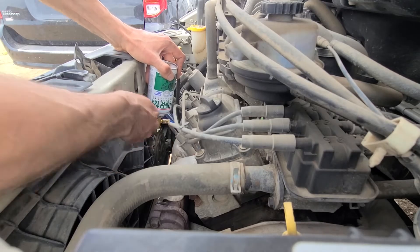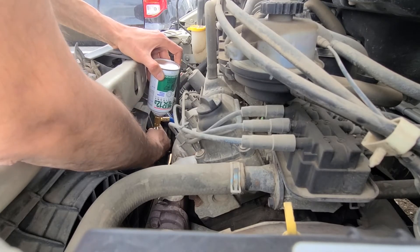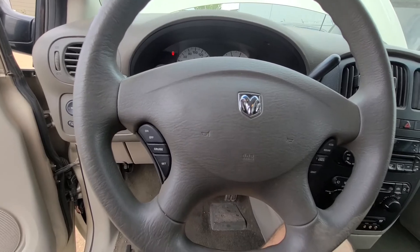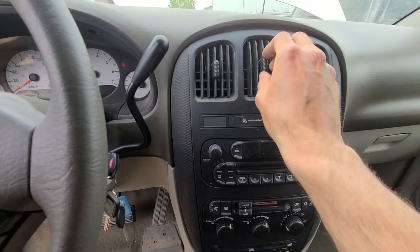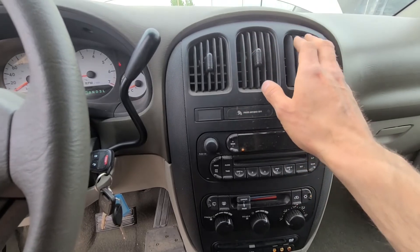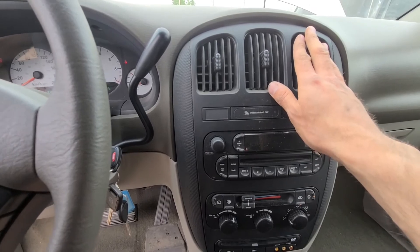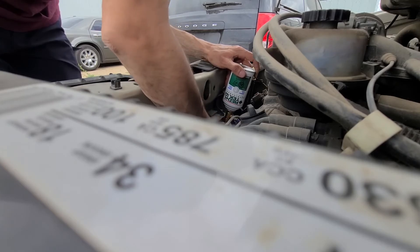Make sure to keep checking the pressure at all times. I will go inside to see if I am getting anything. I like to check with my hand if I can feel the air being a bit cooler. I know this is a big van and the system is quite large — I've only put in about half a can. But I do feel it being a bit cooler. I will proceed outside and continue charging it. There is no rush.